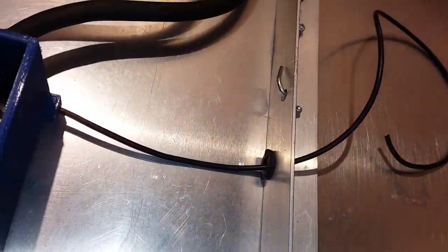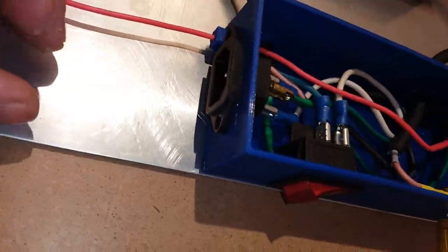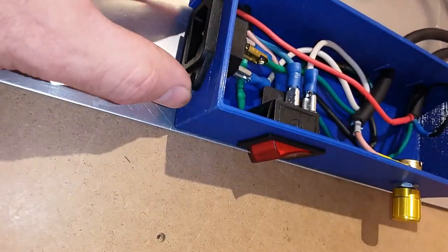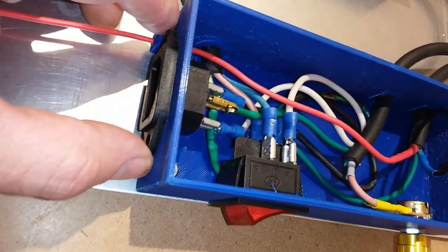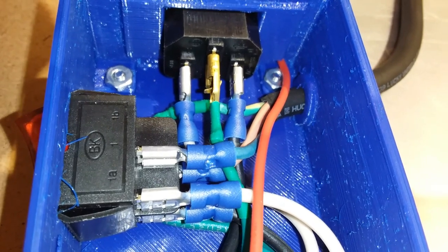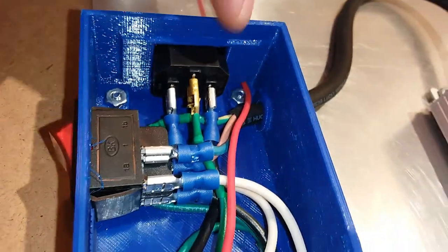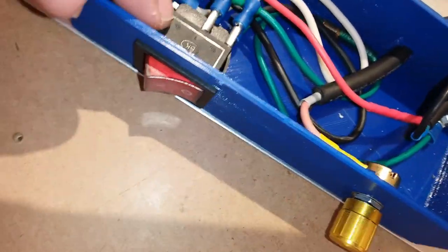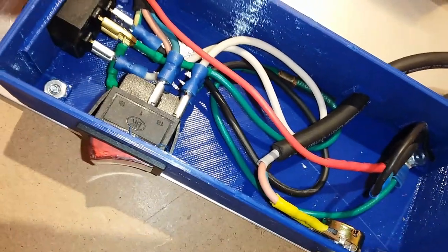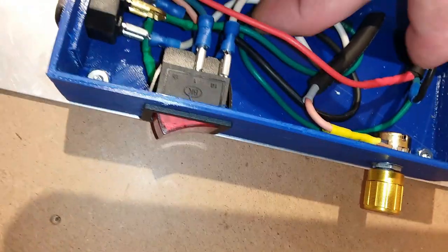And we have the same going on on this side over here. For the power coming into this thing, we have your typical little plug here for your cord for your AC from your wall. You can see the top center pin there is the ground, and the two on the side are the line and neutral. The line and neutral come out and around and go to the switch. Power coming in from the wall goes to the top of the switch, with your neutral.